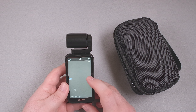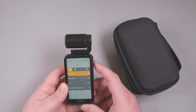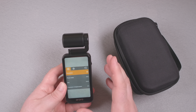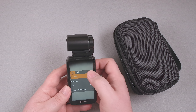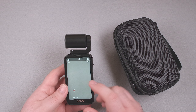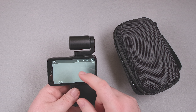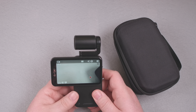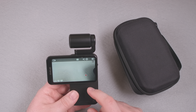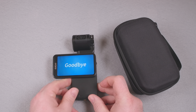The touchscreen works well enough to navigate the menu, and you can also use the rocker switch, but it keeps locking up — the touchscreen is much easier. You cannot access the menu while recording, which means you can't change things like exposure compensation while recording. The white balance menu has a color temperature setting allowing for semi-custom white balance — a first in any generic camera I've looked at — but the one time I managed to select it, I couldn't adjust it far enough to get where I wanted.